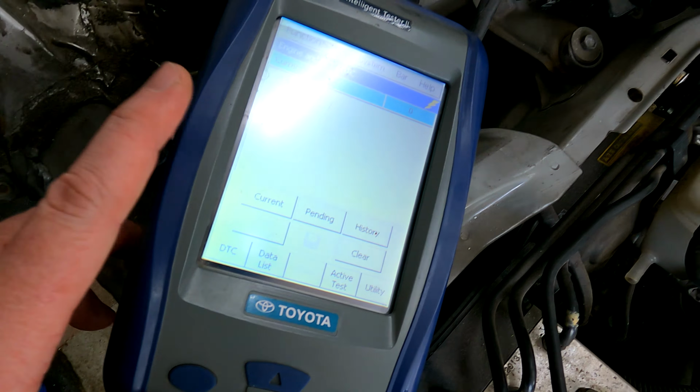But basically when it gets to you, you're going to take your power cable, which is the one that comes out the back here. You're going to take that to your positive of your battery. Make sure that this little cable that goes from the battery into your fuse box here is also connected. So you should have 2 connections on there. That's obviously for your car, that's for the starter. On the negative side, you've got your negative battery terminal, and that is a negative cable which goes down under the battery, bolts to the body, comes down there, and then you need to bolt it onto the block to create an earth for there.